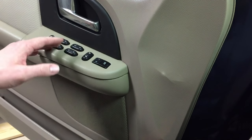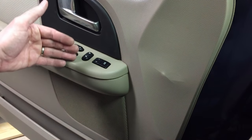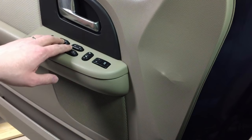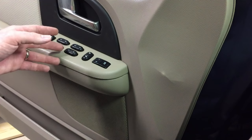Try these two tricks and while it's happening you'll know with confidence it's a switch. Either way, if you have an intermittent issue where the window works fine one day, works fine the next, doesn't bind or anything like that — this switch is really, really common, and these are easy to change out.